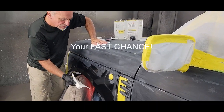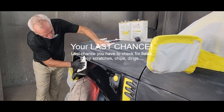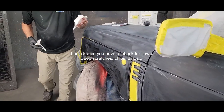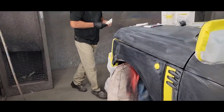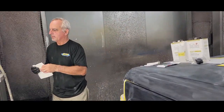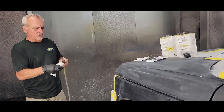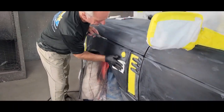This is a good time to check for chips, dings, anything you might have missed, deep scratches — because you can see the shiny area, so you can see what's going on there. Take a dry rag and wipe it off. Do this to the whole vehicle. Once you get that done, take the dry wipe-all or rag or whatever you use — make sure if you use a rag it's lint-free. You can use Wipe-All crew 400s. Basically go around the whole vehicle, blow it off, and wipe it at the same time.